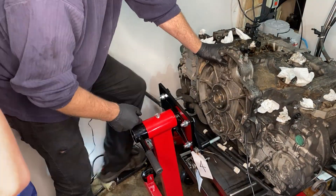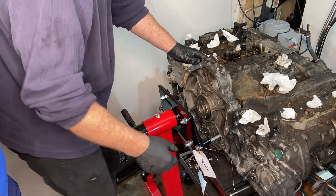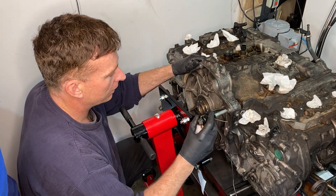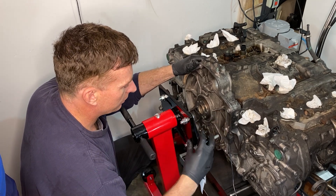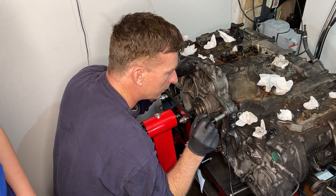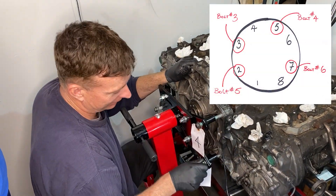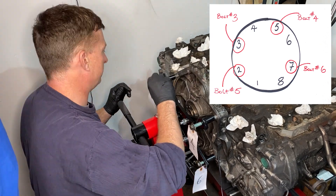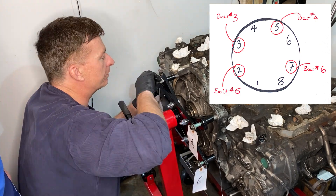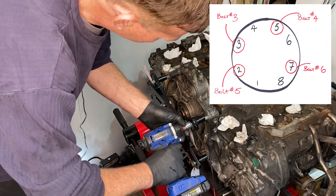The first time the rollers kind of shot out, but the second time it was amazing — I swear I could have pulled that engine backwards and forwards with one finger. So then just gingerly pulling the engine towards that first bolt. Now these bolts are the bolts that were holding the engine to the transmission. You may remember from episode 10 we talked about the different bolts holding the engine and transmission together. Bolts 3, 5, 4 and 6 were the longest bolts, and that's really why they won. Those holes seemed to make sense because of how deep those particular holes were and the fact that they were spread out around the bell housing.